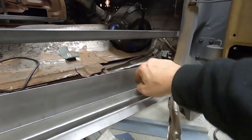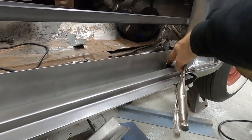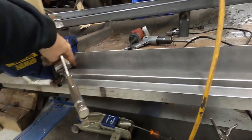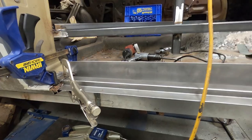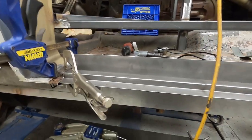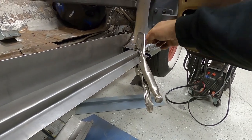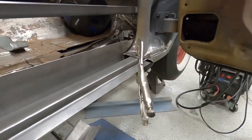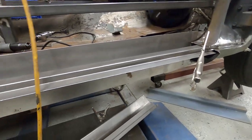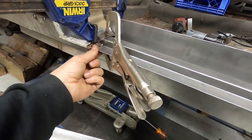What I'm going to do is take this rocker — the rocker top we made has a nice high edge on it so it can be trimmed off evenly. I want to make a mark from here all the way back to the lower section, cut a straight line across, so it's nice and flush. I'm going to drill through the top and do spot welds from the top as many as I can, then when I flip the car over on a rotisserie I'll go ahead and get it really good from the bottom.